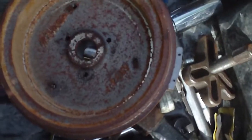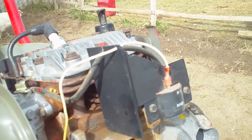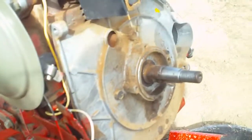So we're going to put the key back on - the keyway is right there located in the flywheel - and mount the flywheel back on. I'm going to rewire and test with the ohmmeter. I'm going to rewire these kill switch wires, these white ones that go in there and mount to the side of the block. There's the bottom tab and the top is already connected. We cleaned them up and tightened them just in case they weren't making good connections. Hopefully it was just a bad ground - the connection for the kill switch - because this does not have points.